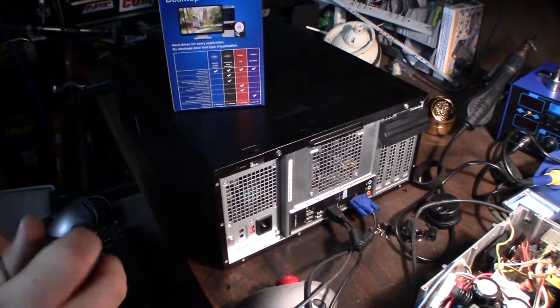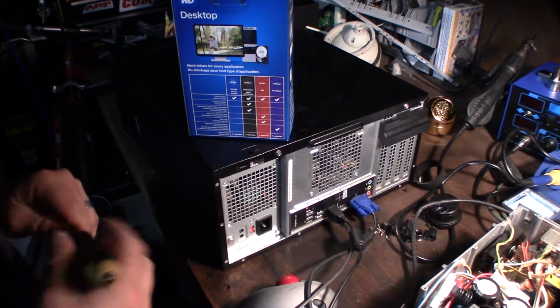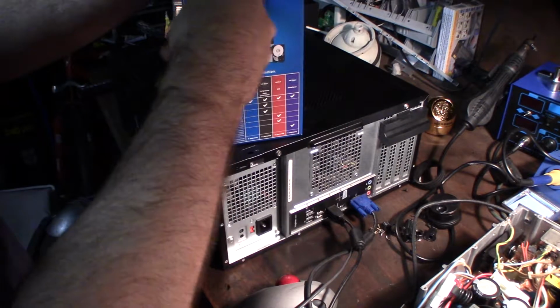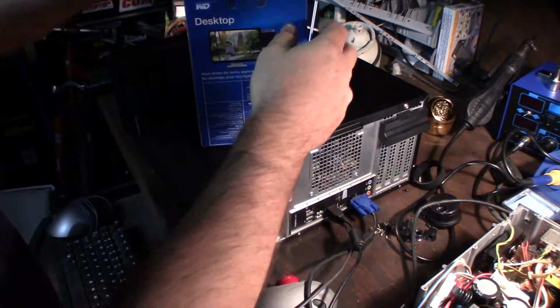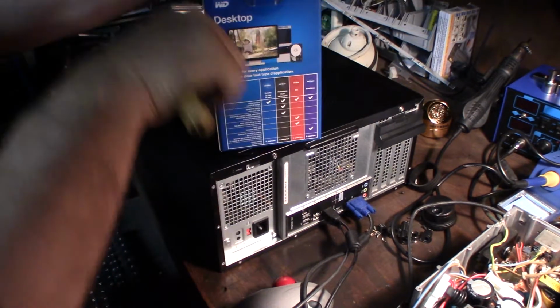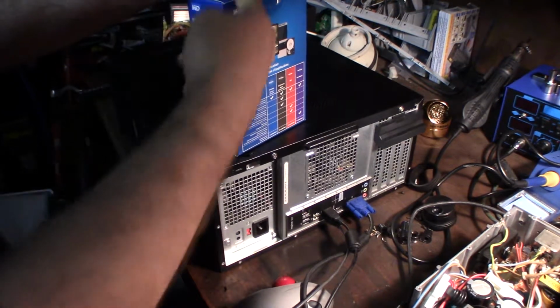Hey guys, what's up? So I had a customer bring me a computer that had a failing hard drive. It's acting funny, doing one of those repairs on boot up. It's actually getting a SMART hard drive error on boot up. So I thought I would show you guys how to clone a drive using Clonezilla. It's an open source product, sort of like FileZilla, it's the same group.